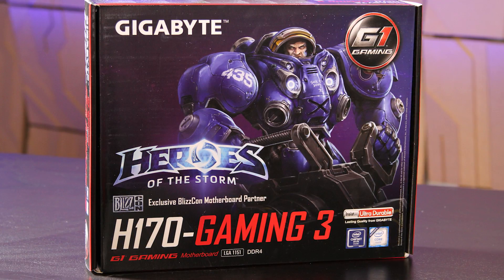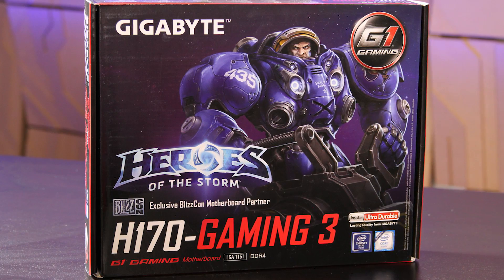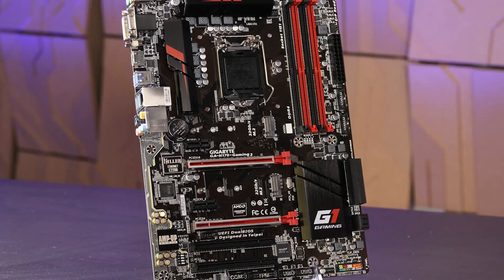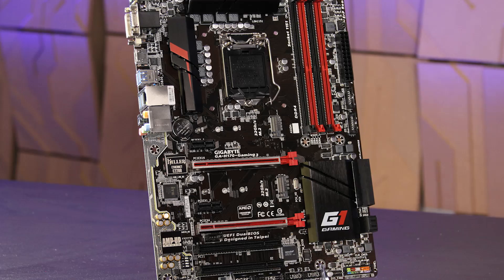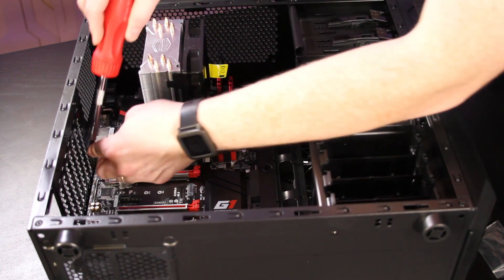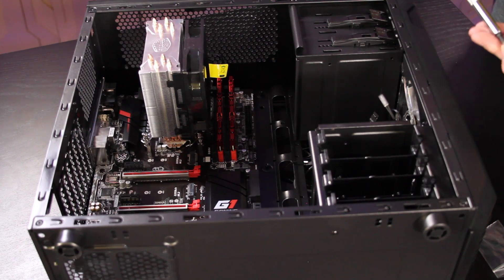When it comes to the motherboard, is this just a sub-$100 board that's strong, easy to use, and has everything we need? Pretty much. The Gigabyte H170 Gaming 3 is one of dozens of boards that could fit in this category. It has six SATA ports, two M.2 ports for much higher-speed storage if you want to upgrade later, gigabit networking, and upgraded audio quality for gamers. We're looking at a $94 motherboard that supports our processor and video card, has all the USB 3.0 ports you'll need for connecting the Rift or Vive, and has the features required to get a gaming PC off the ground.